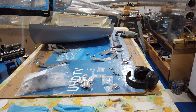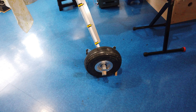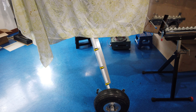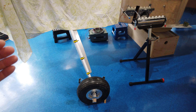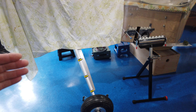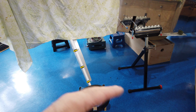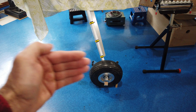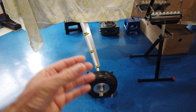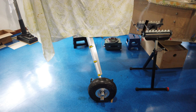Now I've decided to go back to my wheel pant fairings. You may remember from quite a while ago in my other videos I had talked about wheel pants, gear leg fairings, and intersection fairings. I had gone through the layouts — getting the plane level fore and aft and left and right, laying down plumb bobs to get a centerline down the center of the fuselage, taking measurements, laying down tape, getting the wheel pants on parallel to the fuselage and parallel to each other, and getting the gear leg fairings on straight.